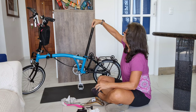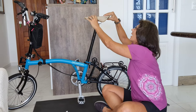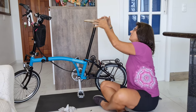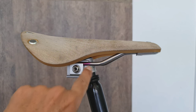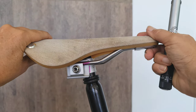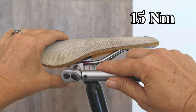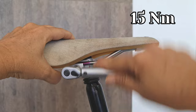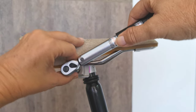Let's put the o-rings back, and the saddle. Our saddle is marked, so it's easy to fit back. Just put it here and put it straight. I'm going to use a torque wrench. It did move just a little bit, so we just put it back — that's the great thing about marking. I already set my torque wrench to 15 Nm. Let's tighten it very slowly to the right torque. Yep, that's it. The cleaning part is done. The seat post is very clean and settled back to the place it belongs.